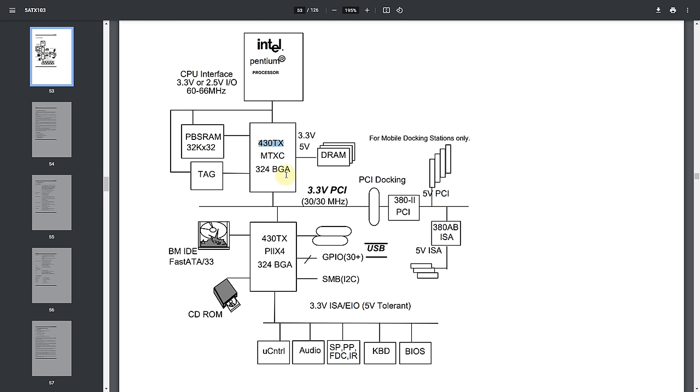I can't remember the exact details, but I believe it's how DOS addresses the memory. It will use the cacheable memory first, and then if you use more than 64 megabytes, then you will lose performance. Whereas on Windows, I believe it's the opposite, something like that, but don't quote me. And yeah, the bottom line is, for maximum performance at all times, stick with 64 megabytes of RAM on such a mainboard. I believe that's heaps, even for Windows 95.